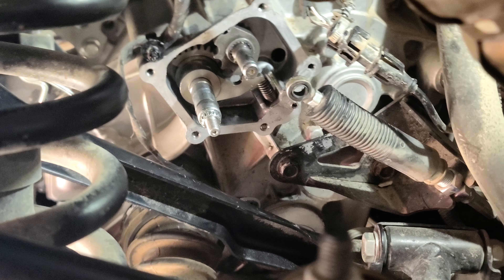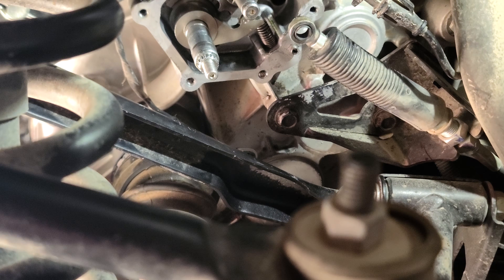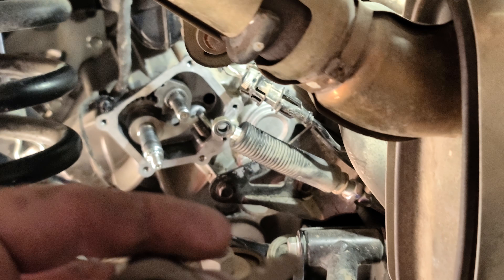Here's a short video on this 2021 Polaris XP1000 Ranger — applicable to any of the 1000 Polaris models. This shifter was stuck in high-low but wouldn't go to park or neutral. It's all because the detent inside is broken.